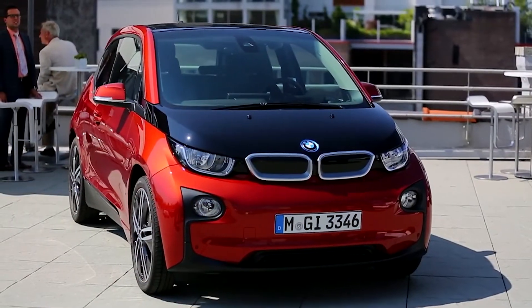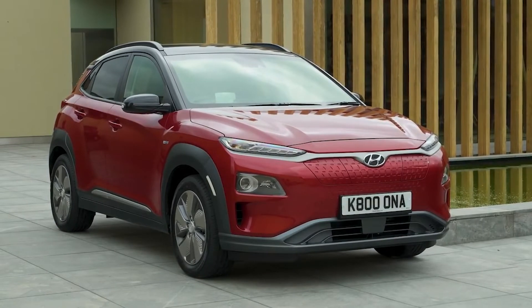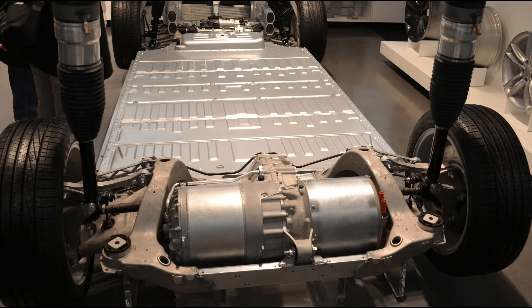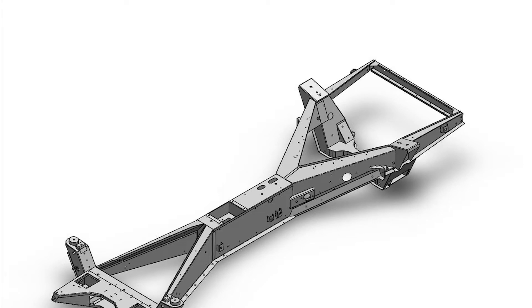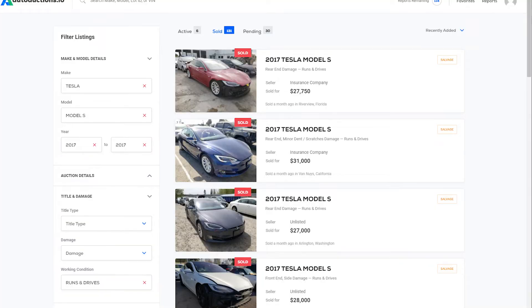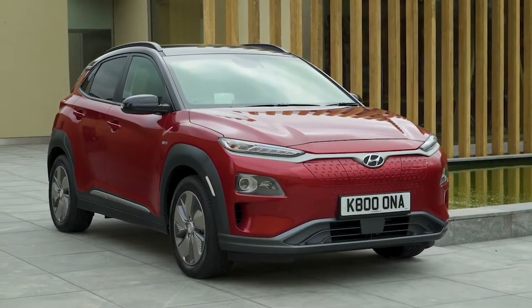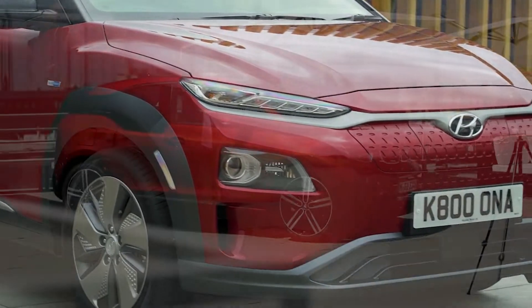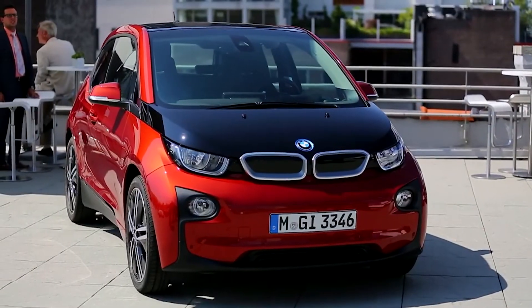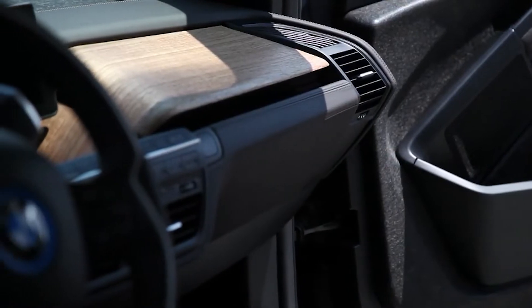I narrowed them down to a short list: the BMW i3, Chevy Bolt, Tesla Model S and Model 3, and the Hyundai Kona EV. After some more investigation, the Tesla Model S was dismissed because the electric motor and transaxle is too large to fit between the frame rails on the DeLorean, and would require more modification than I'm comfortable with — they're also really expensive, even from a salvage yard. The Hyundai Kona EV and Kia Niro EV, which are essentially the same car, were removed because they are too new and I wasn't able to find a good supply of salvage donor vehicles. Similarly, for the BMW i3, I was only interested in the longest range version and even then it only has 168 horsepower, so I removed it from the list as well.